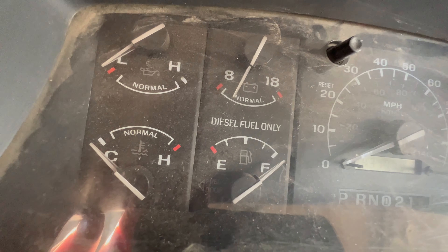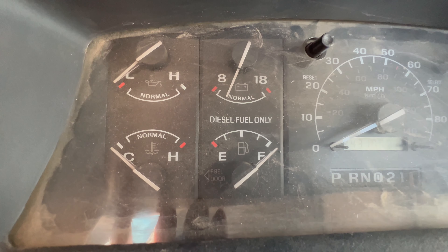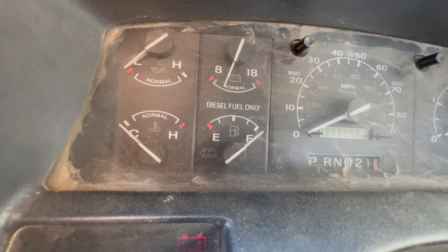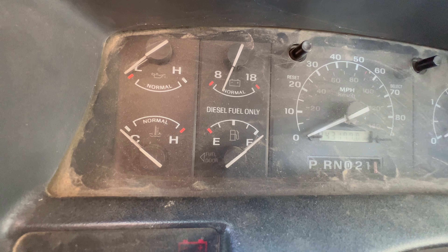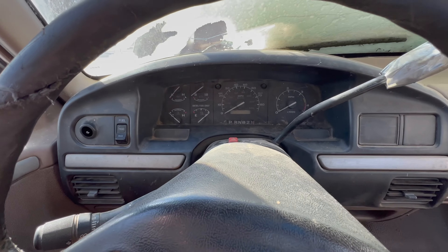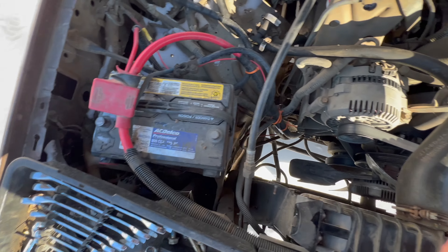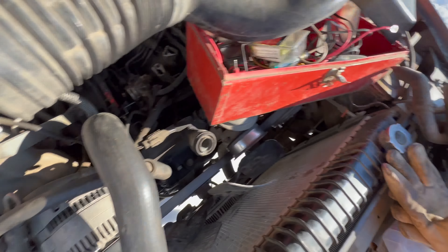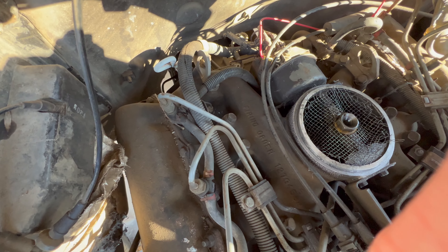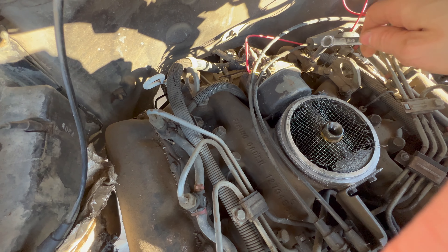See, you turn them on and they're not working. Got some glow plug issues here — see, they're not doing anything. I'm gonna go work on that quick and see what's going on. I might have a ground issue. I'm disconnecting all the batteries, going to clean the ends and test the batteries while I'm at it so I don't wreck the starter. I hooked up a test light — none of the glow plugs are lighting up. So we've got an issue; probably the relay could be fried.